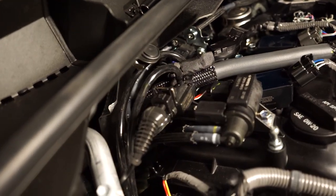From there we are going to go ahead and finish installing the turbo inlet itself. Car enthusiast's worst nightmare - we are missing a tool. We need an E8 socket, which is new to me because I have never used one before. It's like an inverted Torx and it's going to help us remove the stud from the turbo itself. Totally overlooked it before we started the install. So we are going to run out and get one and come back tomorrow morning to finish up. Get a good night's sleep, we will see you then.